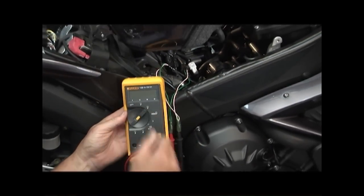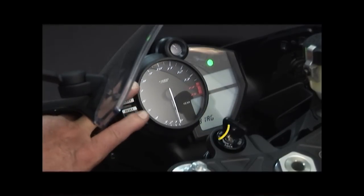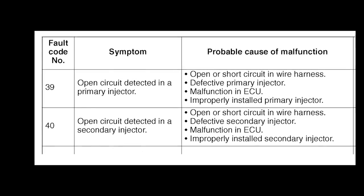So why do we see a spike of 90-plus volts from some injectors and 40 volts from others? It's due to the programming of the self-diagnostic system on each model. Some models have a fault code for a faulty fuel injector, but most models do not. On models that do not have a fault code for injectors, the voltage spike from the injector is suppressed inside the ECU so the spike doesn't damage the ECU or other sensitive electronic circuits. On 2006 and later R6, and some other models, there is a fault code for a faulty fuel injector, and the self-diagnostic system is programmed to look for that 90 peak volt spike to determine if the injector is working or not.